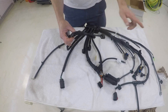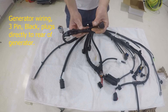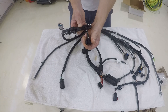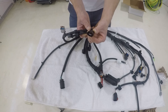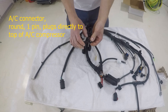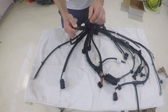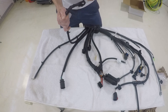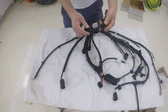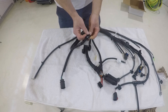Next in the loom, they've got this taped up but it runs quite a ways further. This one goes to the back of your generator — easy to figure out. It's a three-pin connector, black, and goes directly to the back of your alternator/generator. The third wire is a single-pin red wire. This goes to your AC — it's the only thing that feeds power to your AC. Really easy to identify because it's a circular plug with no locking pins on it.